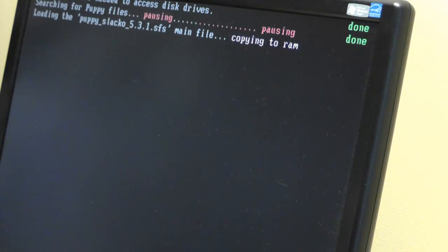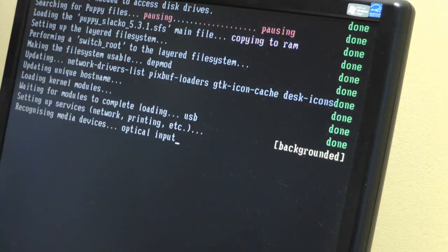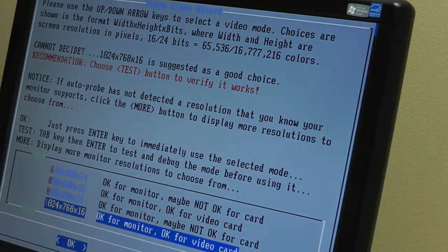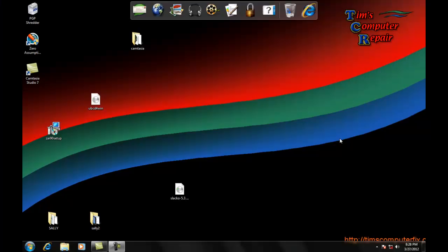The load times are increased dramatically using this method with this VE300, especially if you're using USB 3.0. The load times are incredibly fast, much faster than using a CD drive. So it will save you time. This also works well if an old computer doesn't support booting off of USB, it will boot off of a USB optical drive, which is the CD-ROM drive.